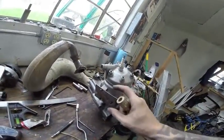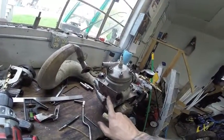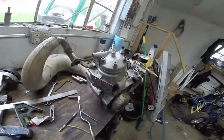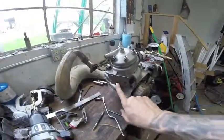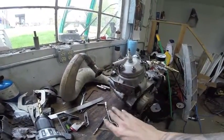For the 85 head, we're going to take this off and show you guys. There is a weird exhaust port — it's not round, it's oblong. So we weren't able to use our normal freeze plugs. So we made up this plate, put a little RTV on the head itself, bolted it down, and we got a nice seal.